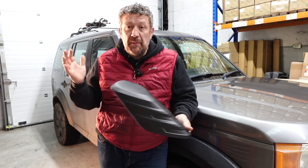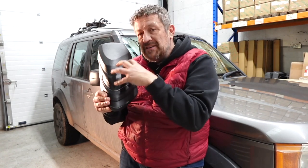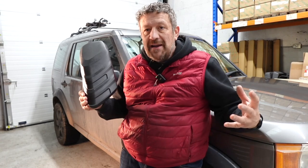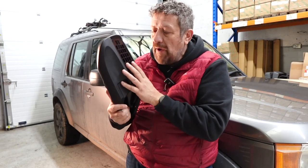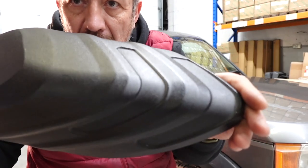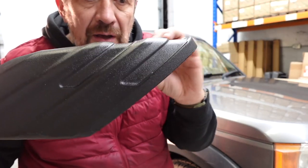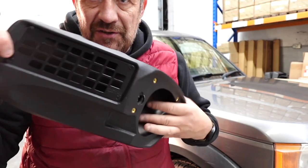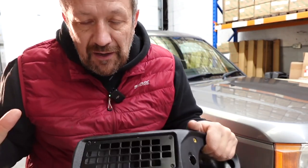This kit couldn't really be simpler - it's just a two-piece kit. You've got the main body of the snorkel and you've got the top. What's interesting is it doesn't have any front-facing ram style apertures, so there's no air going to be blown into the raised air intake. It's all in the back, so they're hoping you get a vortex created around the back of this snorkel top. It does have these scalloped pieces out the front, and I might actually open those up in the future and put some mesh on there to ram some air into the intake. If I do that I'd have to block the back off otherwise air would just go in the front and out the back - but that's a whole other video.